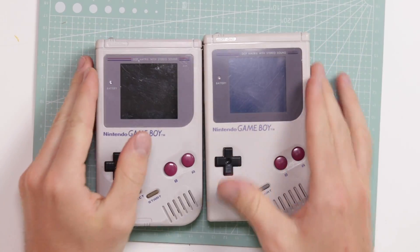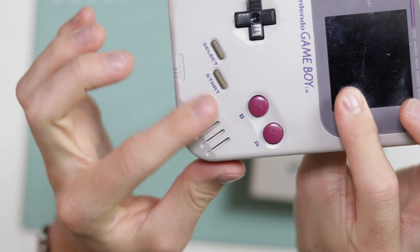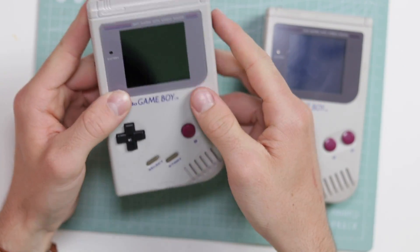They're done. I'm really pleased with the overall results. As I said earlier, retrobrighting is a very hit-and-miss thing. I left it in there for too long — I went into town and forgot about it, and it was in there about three hours too long. That has caused a few problems: there's a little bit of streaking down in the bottom corner and around where the speaker is. But realistically, it's far better than it was before. Also, he didn't want me to stick down the lens because apparently he's got a new one, so I'll just leave it unstuck for him to replace himself.